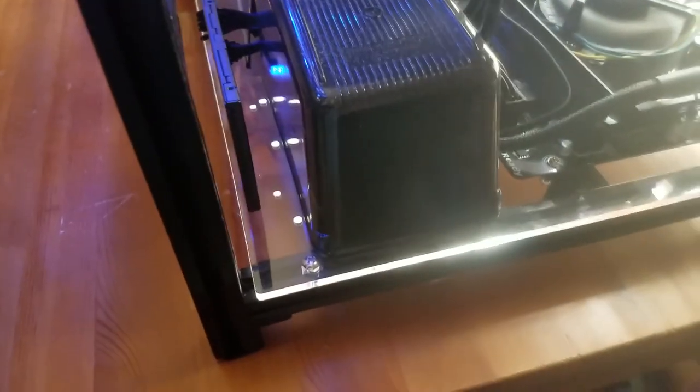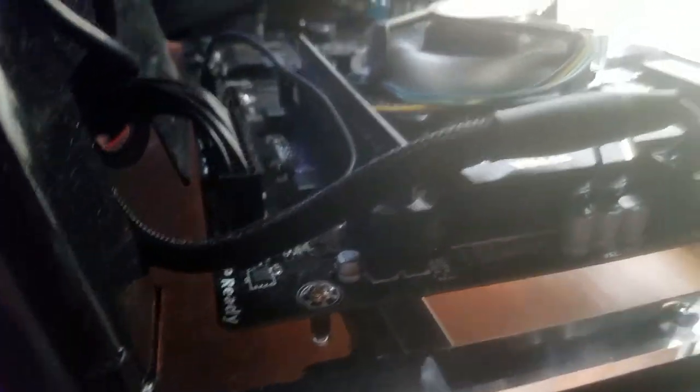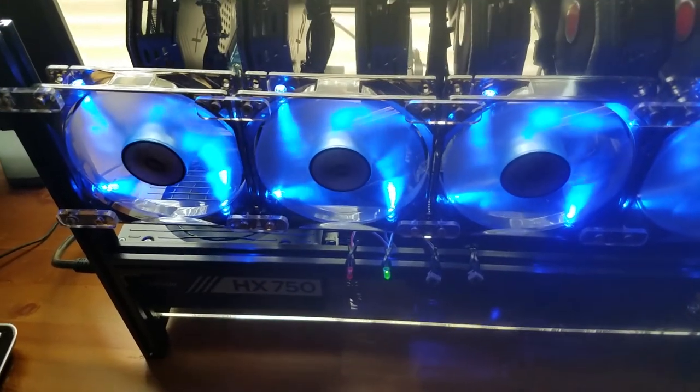I made this custom wire cover out of a little plastic refrigerator organizer bin. It was kind of clear plastic, so I painted it black so you couldn't see the wires right through the plastic. It's got a 120GB Kingston SSD, a G4400 processor — which is a Pentium dual core at 3.3GHz — and an 8GB stick of memory. I built that through Christmas and into early January.